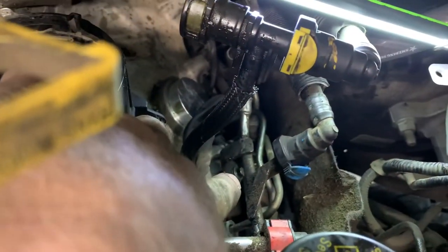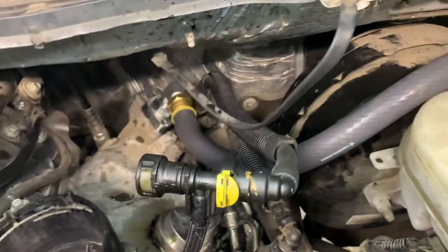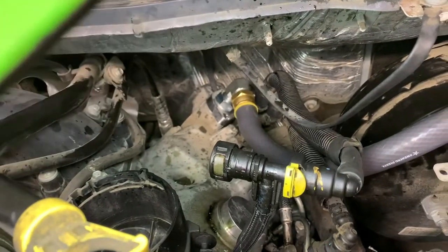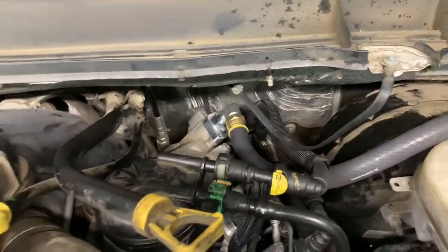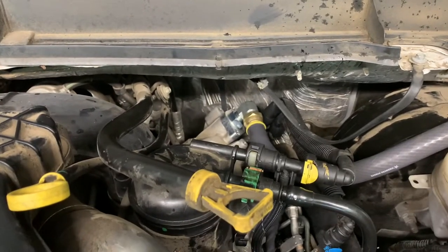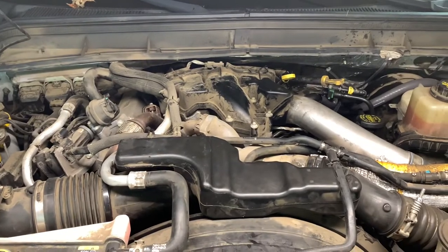We may have to trim a little bit. I had to take this bolt out in that fuel line to move the fuel line earlier to get the crankcase vent filter out. So now we're going to hit all this with a little bit of brake clean to get any oil and grease off so we can make sure we don't have any leaks in the future. Put our fuel filter back in and give it a try. All right, we're all installed - Lee's priming the fuel filter back up. I like removing pointless stuff from engine bays - looks a little bit cleaner back here now. We sprayed the valve cover off with some brake clean to get the oil off. We're going to crank it up in a minute. I'm going to clean the bottom of the truck off so we can check for any other oil leaks.